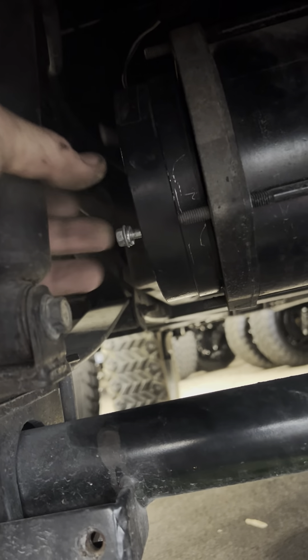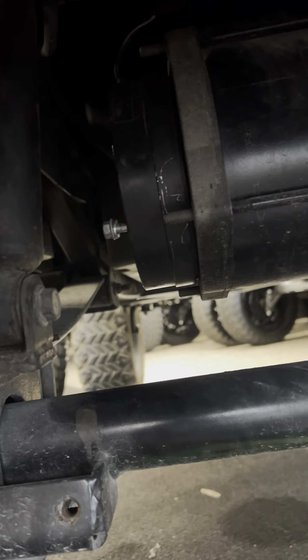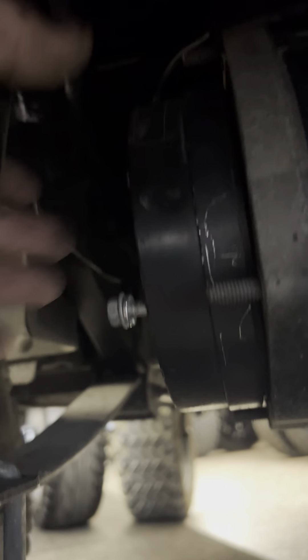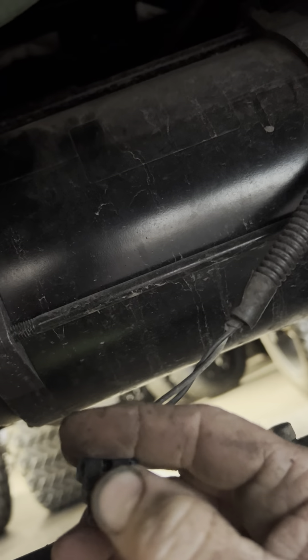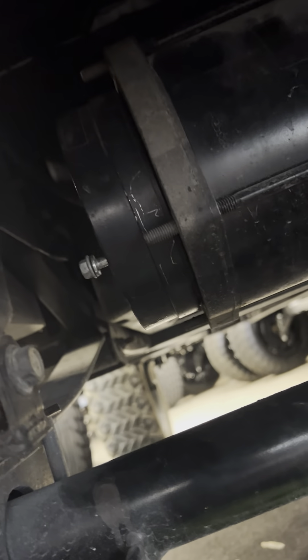What you want to do here — I've already took two bolts out, then I thought I'd show you all a video of what it's doing. But there are three 10-millimeter bolts: one here, one here, and one on the other side. You also have a harness on the top side that you just pick up on the pigtail — you just pick up on that plug right there, and it unlocks the harness for the e-brake.